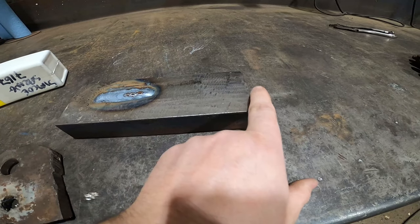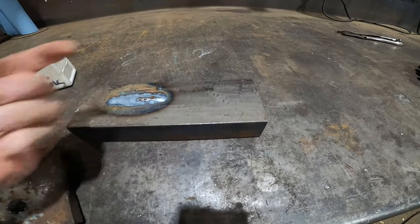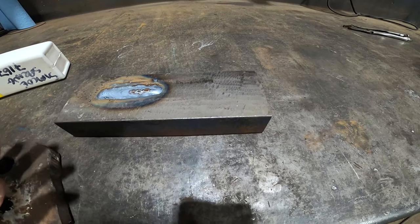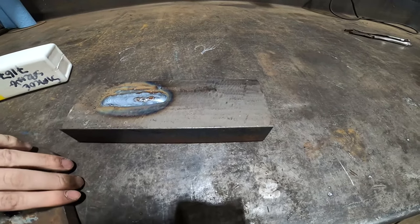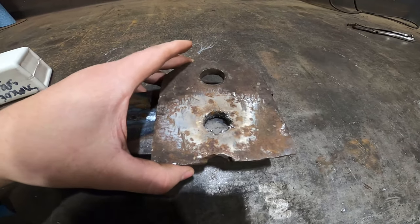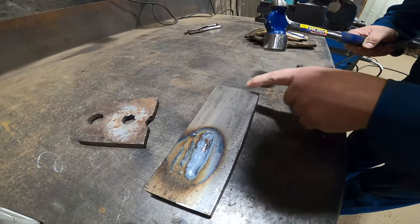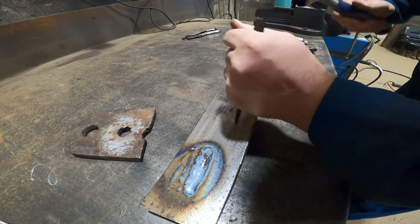What you need to do is just make sure that you measure in from the side and mark it with a sharpie or a center punch so that you can line up your hole properly. Because if you're off, then your suspension's off and you don't want that. I'm just going to pretend this is my six inches over and one and a quarter in, or whatever it is on your axle — just mark it.